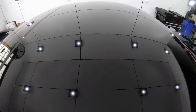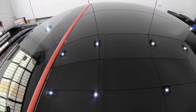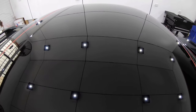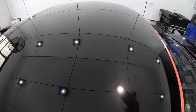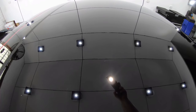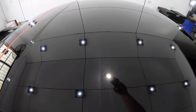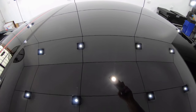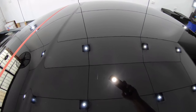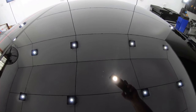Having a look at the results on the roof was actually a little more tricky to assess due to the existing inconsistency of the finish, and also for what turned out to be a softer and far more sensitive single stage paint. And for those of you that have come across older single stage acrylics or enamels, you'll know that they are perhaps the most difficult of all to finish without haze or marring. And due to the increased levels and severity of the defects on the roof, a lighter combination just wasn't able to remove them, but my current combination was just too aggressive to finish well.